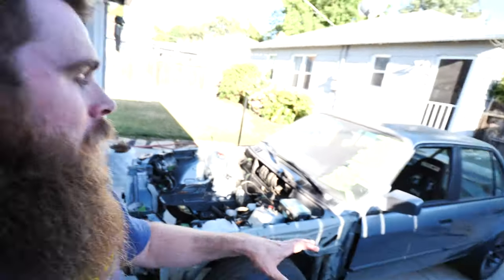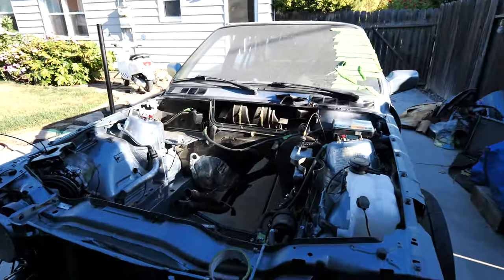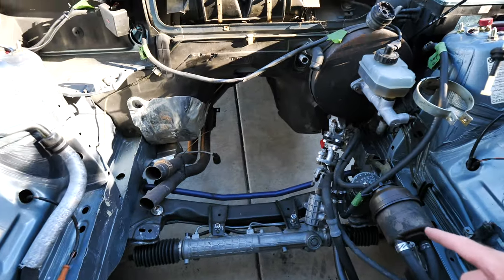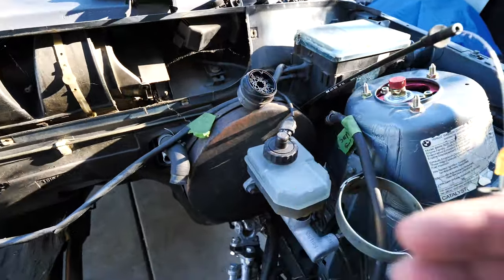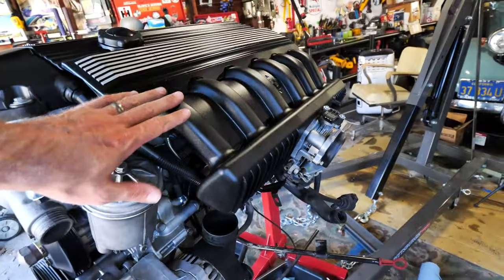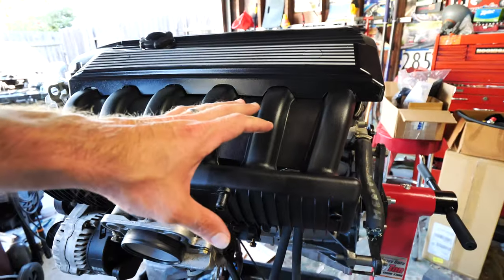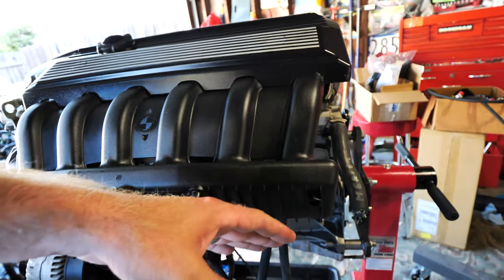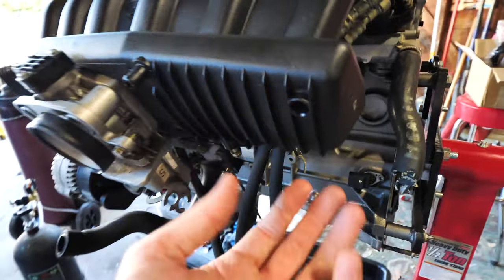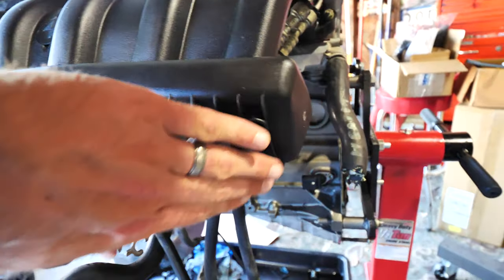Welcome to Blake's Garage. Today we're working on the BMW E30, doing the S52 swap. I'm almost done with all the prep work - I went ahead and reinforced the subframe the other day. Now we need to do that final thing and move the brake booster over so that the intake manifold fits. I'm using the S52 intake, and I may have to shave some fins down, but we gotta move the brake booster.